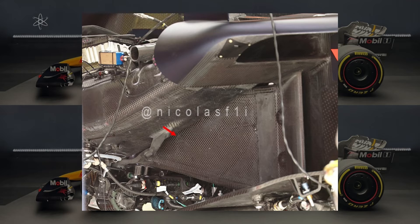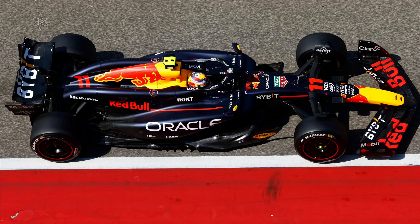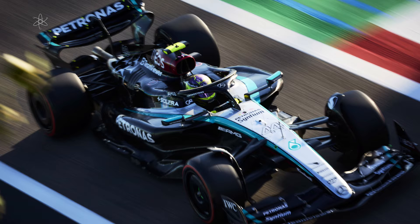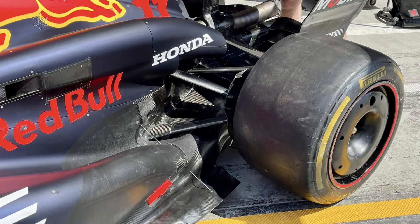It is clearly visible that the vertical air intake is not routed to the cooling system — so what does it do? Are they using this bypass undercut pressured air channel to transfer airflow to influence the top floor exit ramps and beam wing region? The top and rear region of the sidepod has taken a very detailed, smooth treatment with highly controlled contours by Red Bull Racing and Mercedes-AMG on their W15. Maybe we could also add the Ferrari SF24 too. High airflow in this region is significant as it passes the rear suspension to influence beam wing performance.